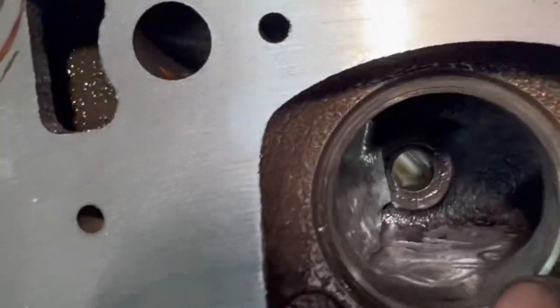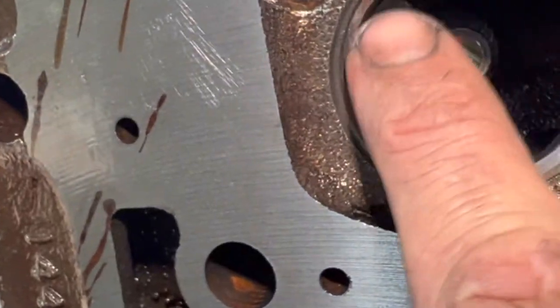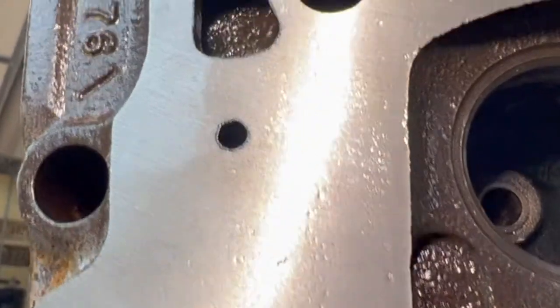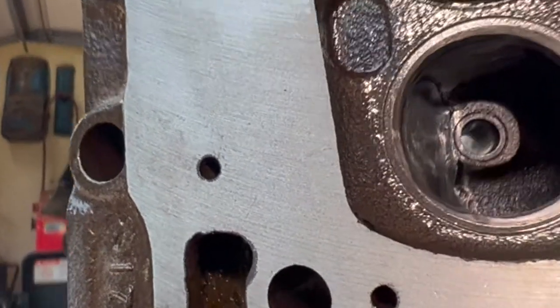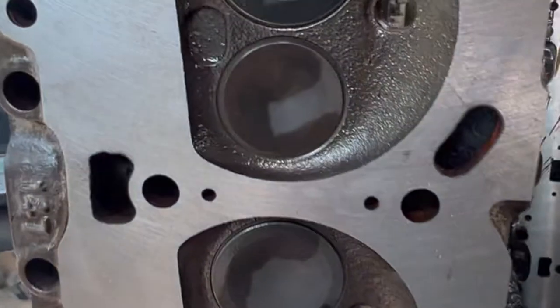I am going to bring them back to the machine shop. This one I think I did pretty good on - not nicking the valve seat. That one you can tell I started getting right there a little bit, so I wanted to pressure test it but I think it would still seat. But this one is the one I goofed up on bad - just got in the moment with a lot of grinding and goofed. Hopefully they can fix that without too many issues.